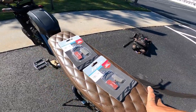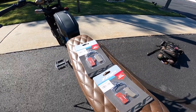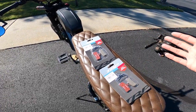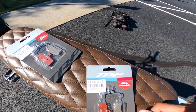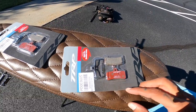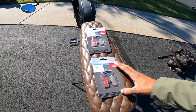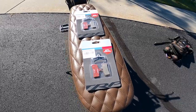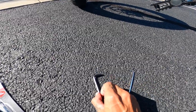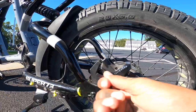Let's get started. I went on the Super 73 website to see if they had the Tektro brakes, but they don't have them in stock at all. I had no clue that brakes are kind of like brakes on cars — you can use any brand, you just got to find the right size. These are TRPs and the number is Q20.11 — I'll put the link down below. I got these on eBay and they were pretty cheap, like 20 bucks. Make sure you guys have a 3mm hex wrench, a 5mm hex wrench, and some needle nose pliers just in case.